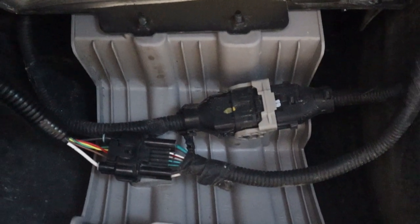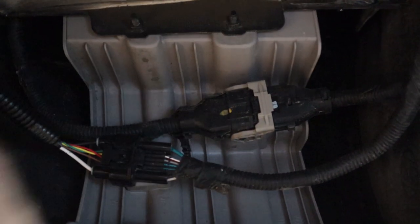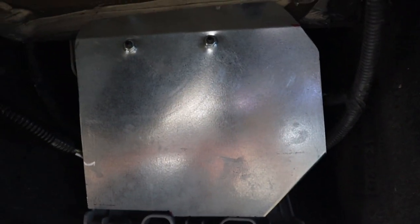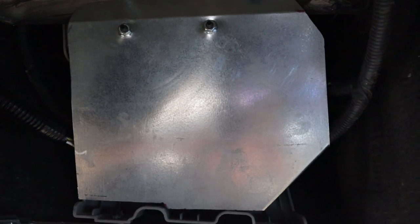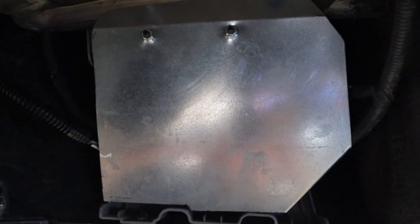Jumping back over to this area — the one mod I told Dana I would be doing is to cover this up. With some cardboard I made a little template. We're going to utilize the bolts up here, and I have some extra sheet metal in the shop that I'm going to use this template to make a cover. Our cover is done — let's go ahead and see how it looks bolted on. I'm really happy with the way that turned out. Just a regular old sheet metal cutter, bend it on the vise, and done.